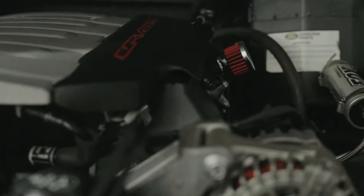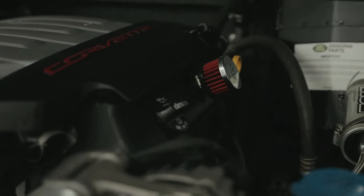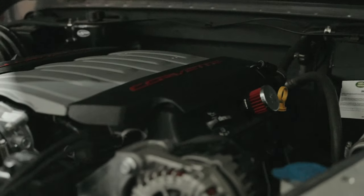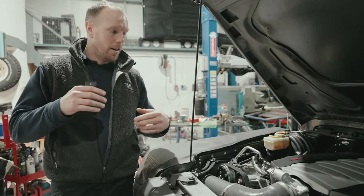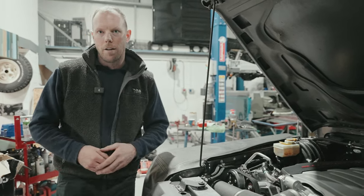So those two little air filters sticking out the side - what are they? They're crankcase breathers. This engine requires crankcase breathing - if there's any pressure inside the block, gases pass the top of the piston and these are designed to release that pressure instead of you popping all your gaskets and seals.